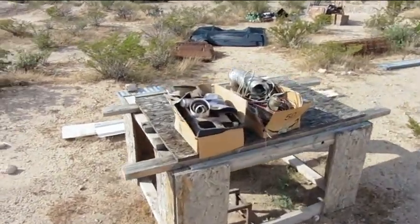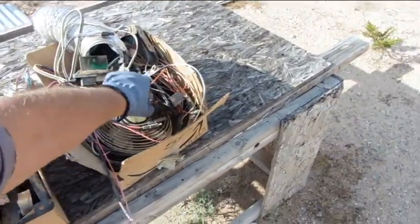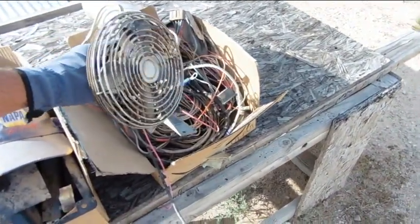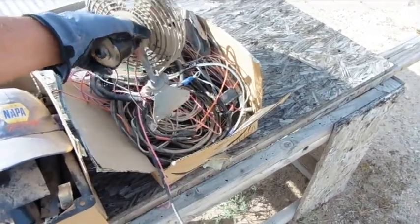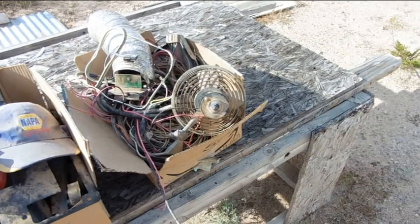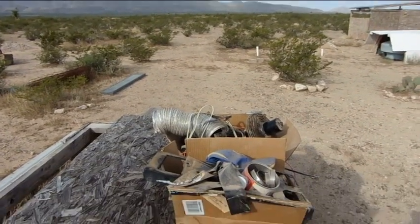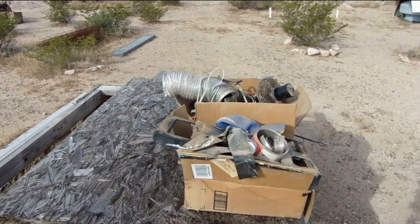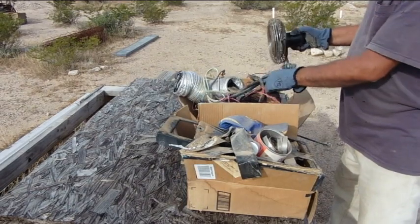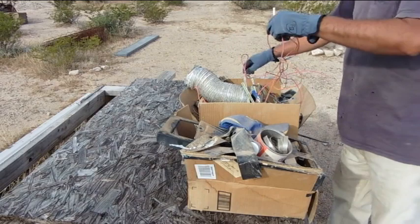What I'm doing — I started thinking, man, I've got a whole bunch of bus parts I might be able to salvage something out of. Like for instance these awesome bus blower windshield defrosters. I never used these the whole time I lived in the bus because they pull so much power. They're perfect if you're running the bus with its 120–150 amp alternator, but if you shut the bus off and ran the fan you'd run the batteries dead pretty quick.